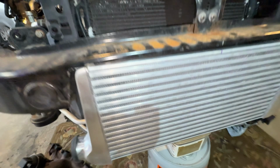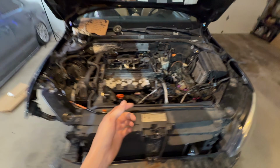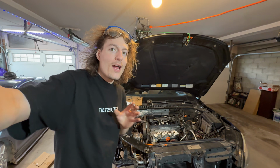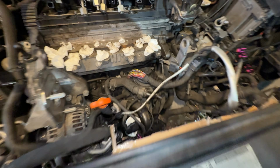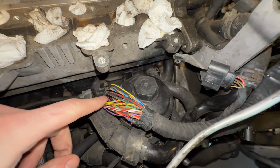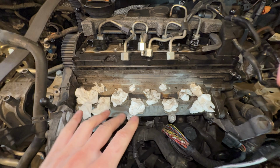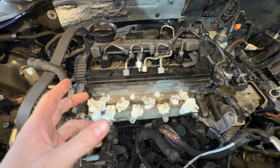And like, oh my gosh, that front mount is crazy. So this car's actually going to be flowing. If you guys have any guesses of what turbo I'm going to be running, definitely throw that below. Also, if anybody here is a wiring expert, I'm running into some serious issues with my glow plugs and they are definitely holding me back and probably giving me issues. I started ripping into the loom and I didn't see any issues, and I even used my multimeter and couldn't find any issues, but essentially these glow plugs short out within like a couple days of being in the car. And my theory is that they actually are always on, but I have no real way of testing that.